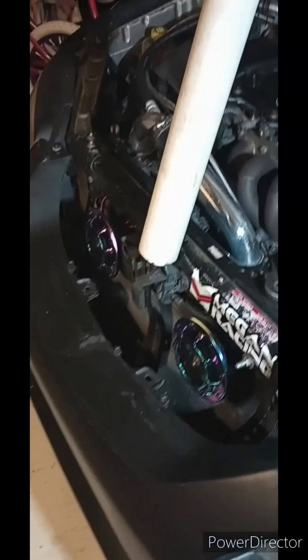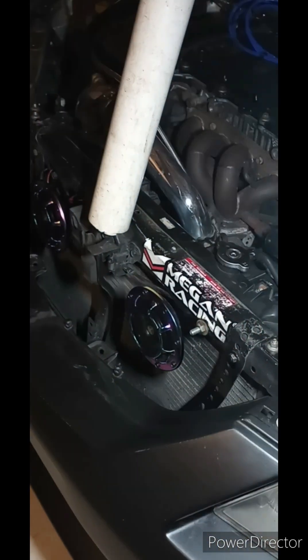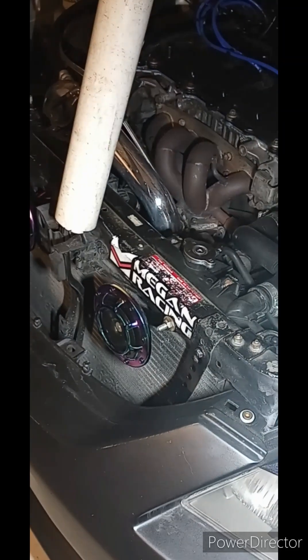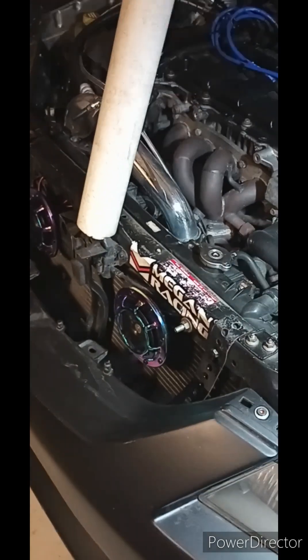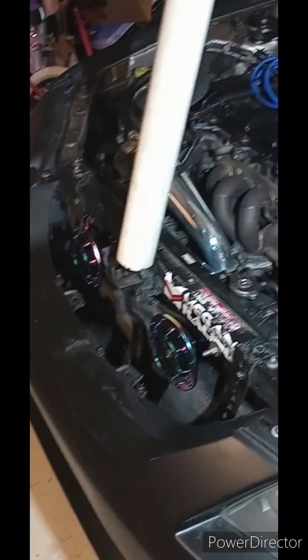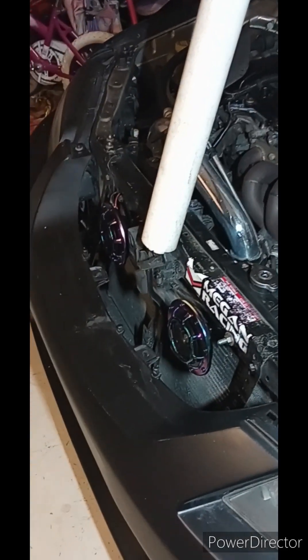So if your horn quit working and you need to rig something up just to be safe, you just need to ground the horn — it's got a nut on the back you can run the ground wire to — and bolt it to your chassis. Then run a power wire from the horn to the button you choose, and then a wire from the button to your battery's positive post. I hope this was helpful and can help someone. Having a horn is better than no horn — please like and subscribe, and I appreciate everybody for the support.